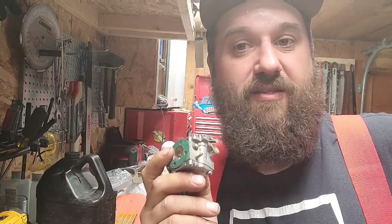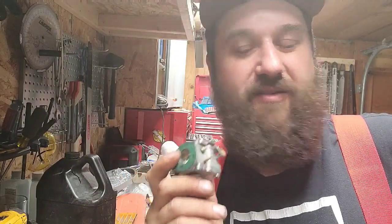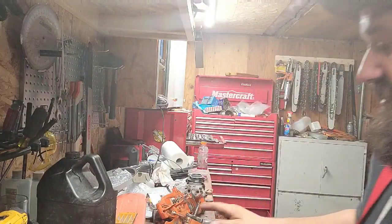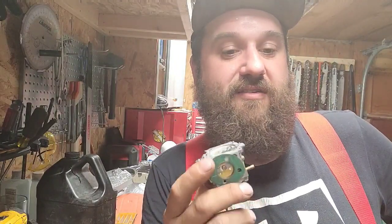I looked at the plug. The plug is brown, but it's on the leaner side of brown. So 13.5 is stock for this saw, okay? So this thing should pull 14.5, I reckon. I don't care what the free speed of the saw is. I don't tune, or I don't port for RPM. They're going to gain RPM when you port them. But I just think if this saw is set at stock 13.5, 13.7, it seems like it's a little lean in the cut.